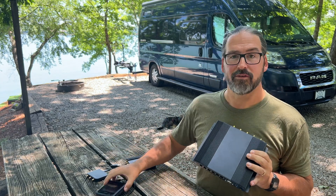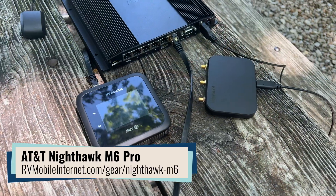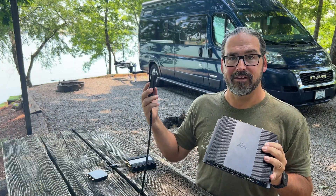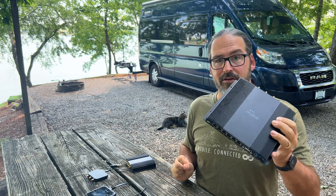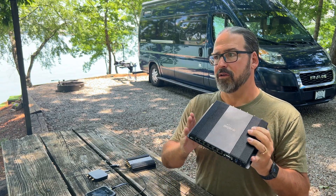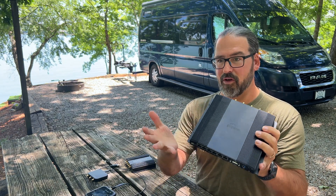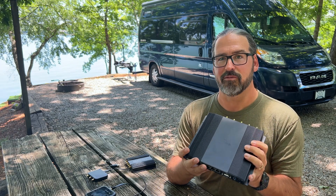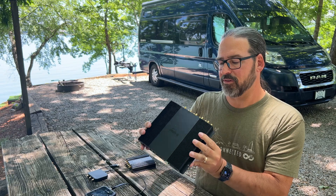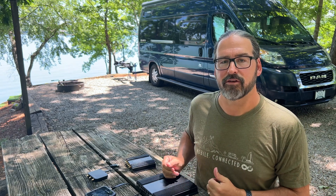One workaround is to use an AT&T 5G hotspot like the Nighthawk M6 connected to the Ethernet WAN port — that way you've got 5G Verizon and 5G T-Mobile on the built-in modems plus AT&T via a portable modem, covering all three big carriers with their greatest 5G possible. Or if you're not in a rush, there will likely be a future version of this with the X65, so watch for that next-generation modem sometime in 2023. That is basically the only Achilles heel in what's looking to be a very nice new flagship for those seeking flagship-caliber cellular integrated routers.